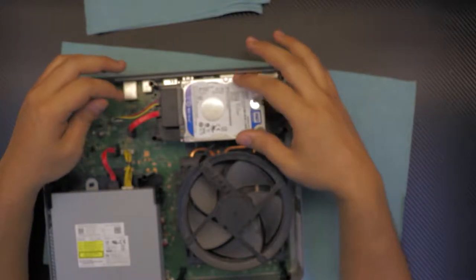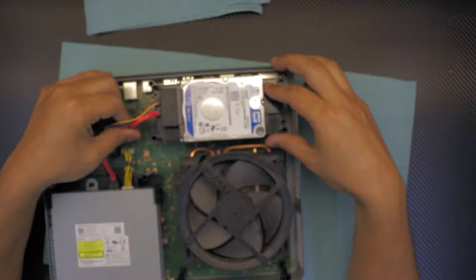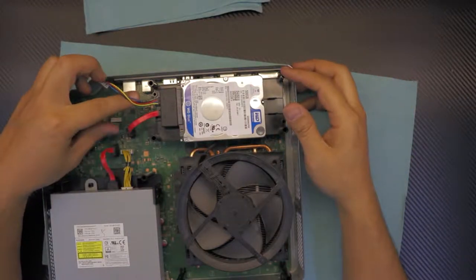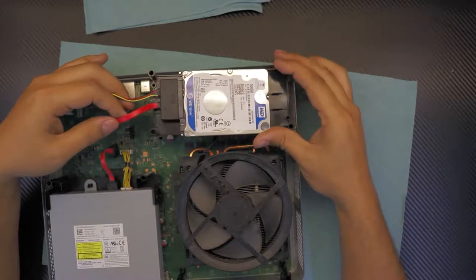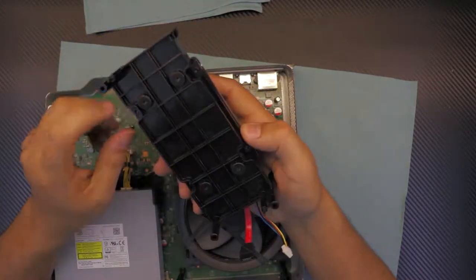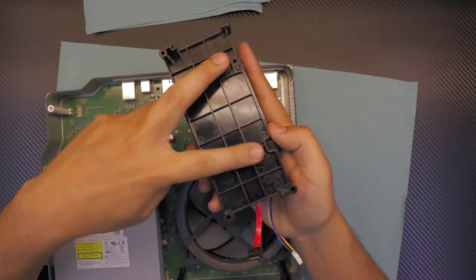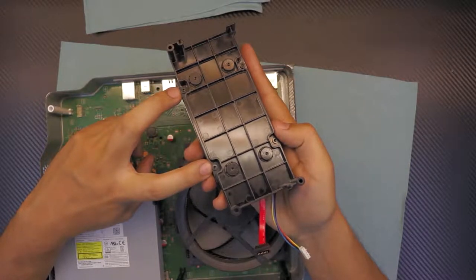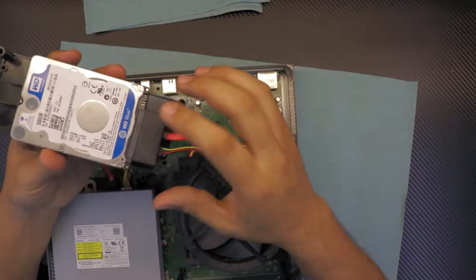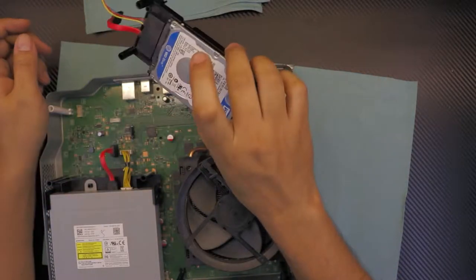Next, this is your hard drive. If you want to upgrade your hard drive, unhook the SATA cable and the power cable, then lift it up. To remove the hard drive there are four screws — one on each corner — but don't remove the inside screws, just the outer screws on the two corners. You can take the hard drive out and put the new one in using the same connector.